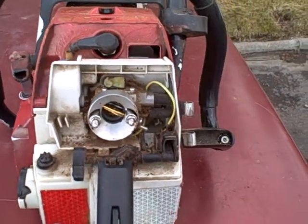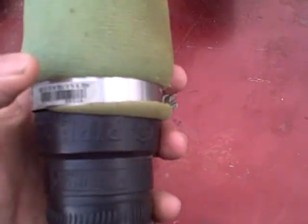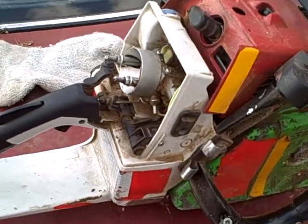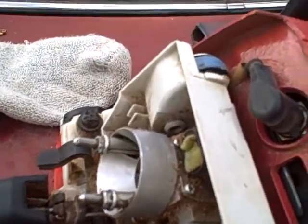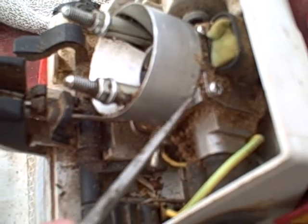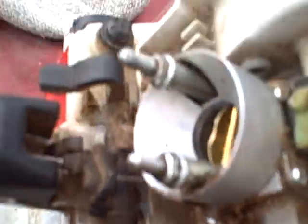Some foam works pretty good. I had a couple of these filters that were cut off short scraps, so I stuffed a couple pieces in there and I clean it out when I clean out my other filter. Now on mine, the one thing you've got to be careful of is there's a little play on Stihls you've got to take out, but these chokes will jam up if you don't set these things right. You've got to be real careful how you set this.